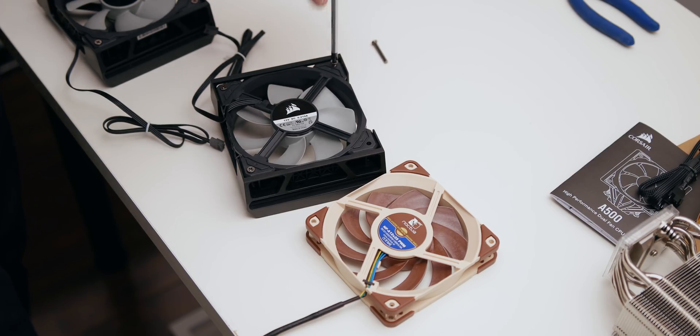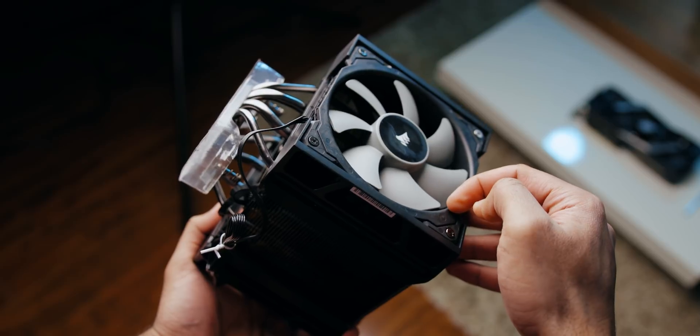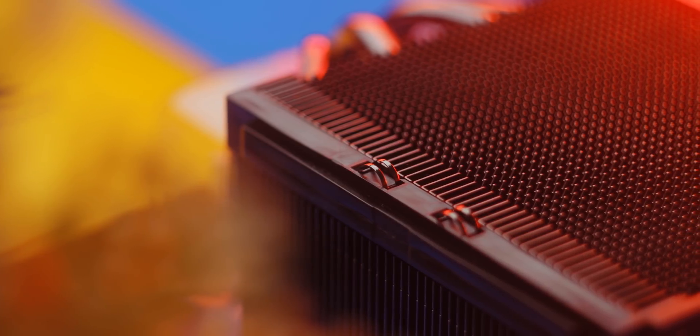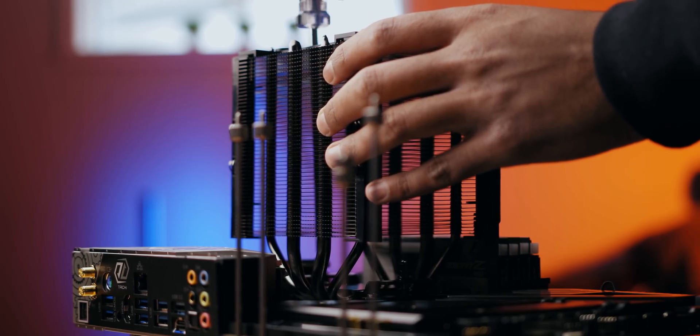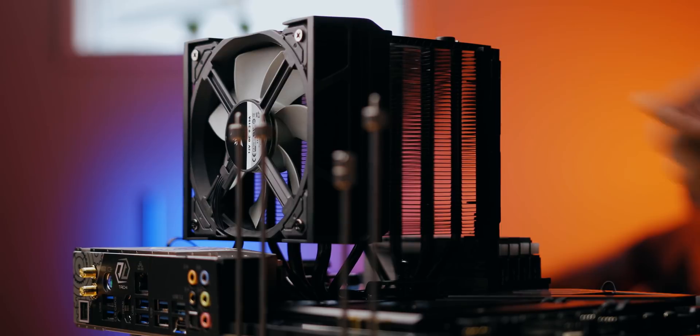So at this point in testing, we wanted to try out one more thing, to test out a theory about Corsair's poor performance. The 10980XE is one of the hottest running chips around, especially when it's overclocked, but according to Corsair, the A500 is rated for 250 watts, and the other coolers in this comparison feature that same spec, but they spanked the A500 pretty hard. So in came the Noctua A12 fans from the U12A, installed onto Corsair's brackets. The A500's fans are optimized for static pressure and are usually used for pushing air through super dense AIO radiator fins, but this heatsink's fins aren't super close together, and that void in the middle could cause problems for airflow movement. The A12s have a lower static pressure rating, but they can move a lot more air at lower RPMs, so let's check it out.